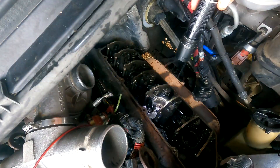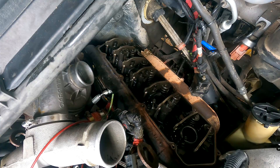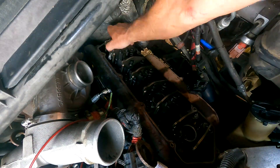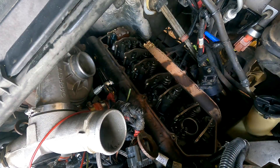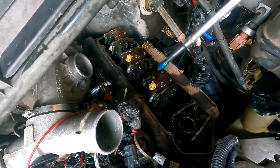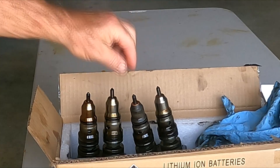Here you see me using a drill with a small arbor set up at 90 degrees and the brushes for cleaning the injector holes. I wasn't gonna do that by hand — it would have been ridiculous. The seal residue is kind of hard. Here I'm using a rag soaked in acetone, which cleans the holes really well. I looked down in there but didn't show that on video. I left the oil sprout on the injector and when hammering down, I make sure the bottom plate is pushed to the inside of the valley so it sits on the front bolt, then I put the bottom side bolt down.